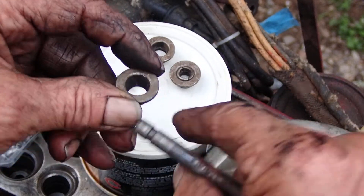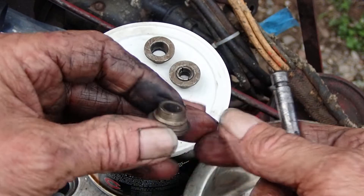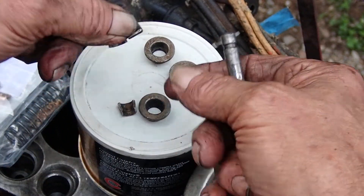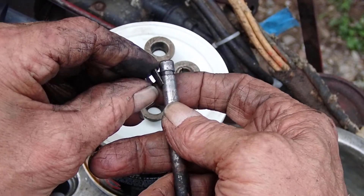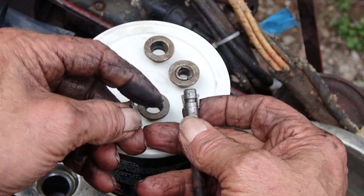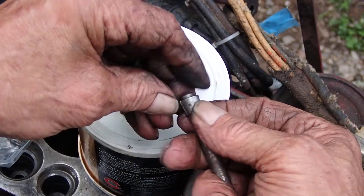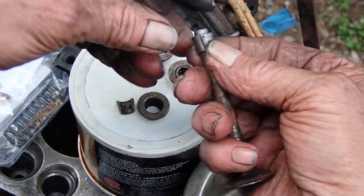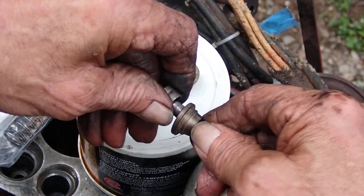Now it's hard to see, but that is actually tapered — a tapered hole. It's tapered on the outside and tapered on the inside. That is so it would wedge two halves of like another nut or disc that has a groove in the center of it. You see how that groove matches up with that groove on the valve? It matches up and holds tight that way. If you put a second half of it together like that, it makes a full circle. That full circle, that wedge, matches up real close to the wedge on the inside of the valve end cap.